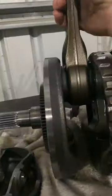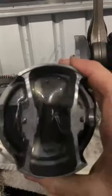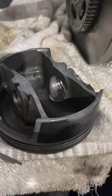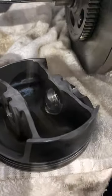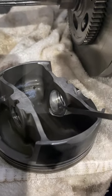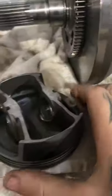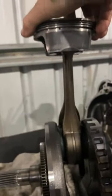The flywheel's separating and we've had a fair amount of side throw to the rod. What's that actually done to the piston? You can see there's material missing off the edge at that corner. With side load, the rod having the ability to move around, it's then pressurized itself against the piston — so when everything's up and together, it's just been doing its job wrecking it.